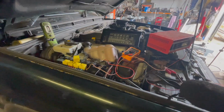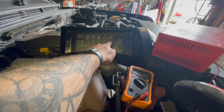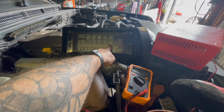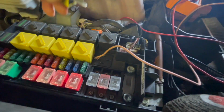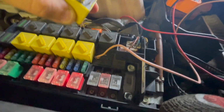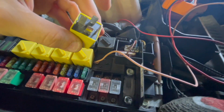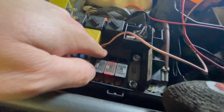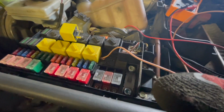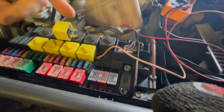Right, had a bit of a play off camera, just so I can show you. Now, relay 1 in the fuse box is for fuel. Relay 1 is here. Basically that back pin there, 5, which is technically pin 87, I think, is the feed to the pump. So I've put a crude live straight in there, over to the battery, and we've still got no fuel pump. So that tells me there's a problem between here and the fuel pump.